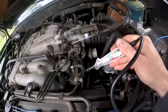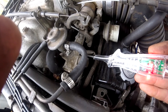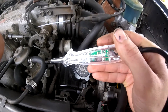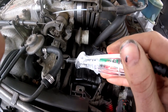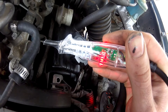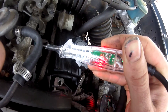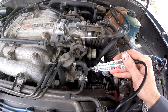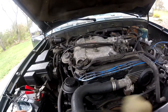Alright, another cool thing about test lights, including this one, is that we can use it to check for injector pulse, crank signal, cam signal, VVT solenoids, things like that — versus where a multimeter doesn't change fast enough or register fast enough to really show up on the screen. But with the test light here, if you look very closely, you can see it's actually flashing — it's not solid. So here we're basically verifying that we are getting signal to the injector. It'll work the same way when testing crank and cam sensors — they may be ground, may be power either way, and some of them actually switch between power and ground. Either way, it's a good little functionality of this test light.